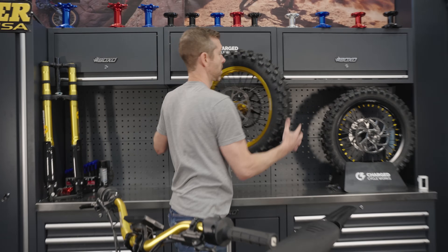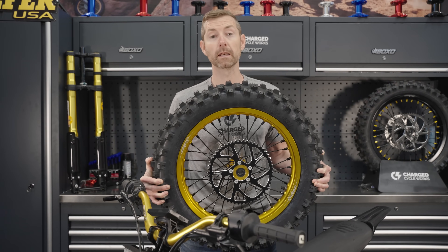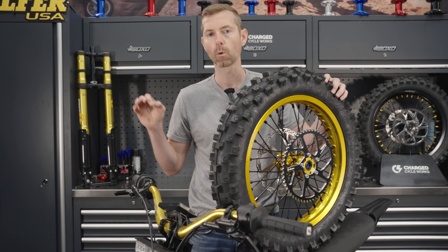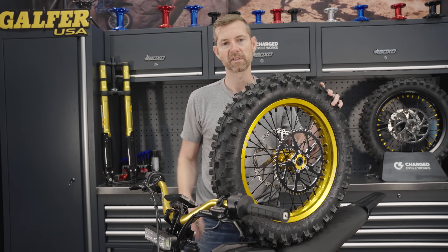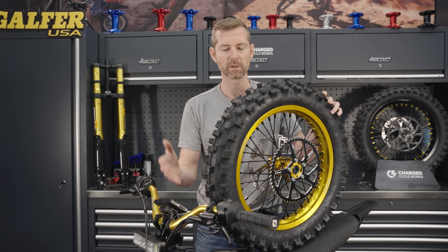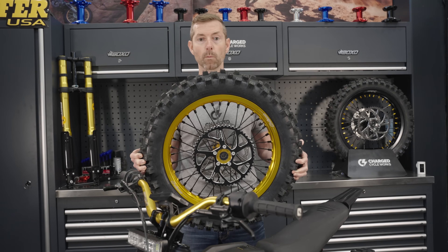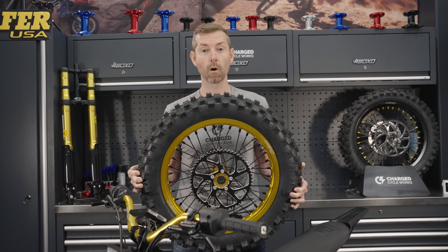Because we're track guys and we're going to be riding on the trail a lot — mostly off-road — we're going with 16-19. These come in almost every color you can think of and they have the best tire selection bar none in the off-road market. The thing I like most is it fits this chassis perfectly. If you go with larger 18-21s, they can overpower the bike — you feel a little more flex and that additional weight. For those reasons, we stick with 16-19. We probably have at least 10 different 16-19 tire options on the website. Since we're going to be riding primarily on the track, we're going with our Tusk T35 tire — our default go-to for most people buying wheels and tires from us.